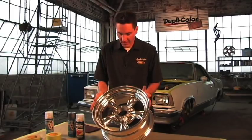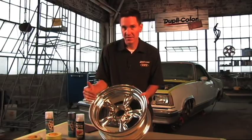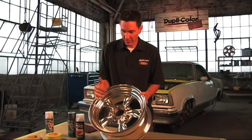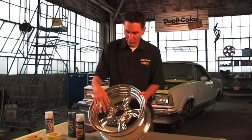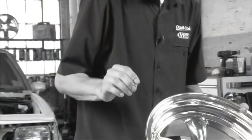What I'm also going to want to do is scuff down the area to be painted, because sometimes these polished aluminum wheels are clear coated. So you're going to want to scuff it down, break that glossiness so the paint has something to bond to. After that I'm going to use the Duplicolor prep spray and then the wheel coating on top of that.